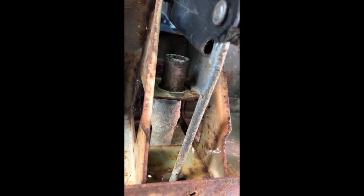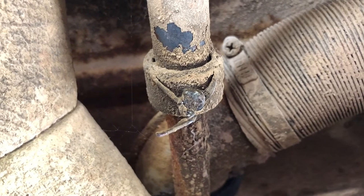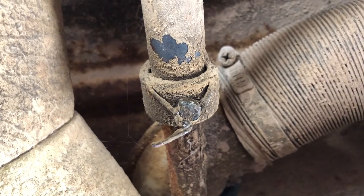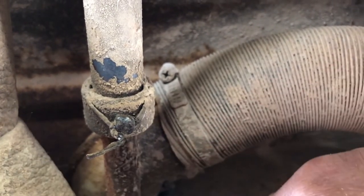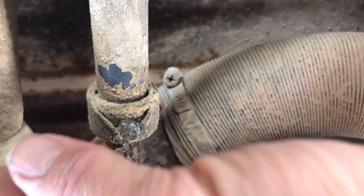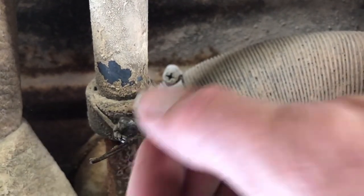My project is to take off the gear shift from above and then, underneath down here further on the shift rod, disconnect the front and rear shift rod and pull that lever up to get the new bushing on. Here is a shot of where the front gear shift rod and the rear come together — this goes towards the rear of the bus, this towards the front — and you have to clip the wire and take out the set screw so they separate.